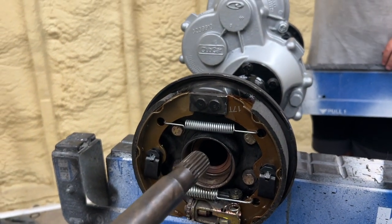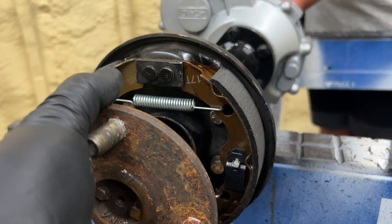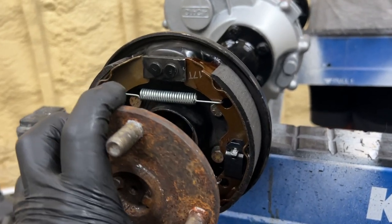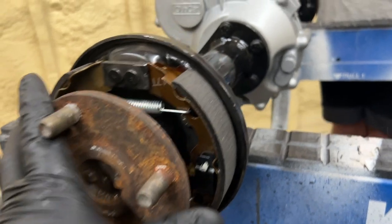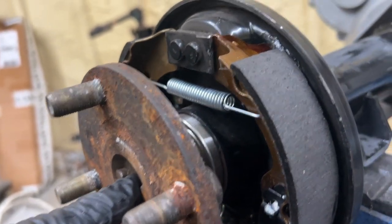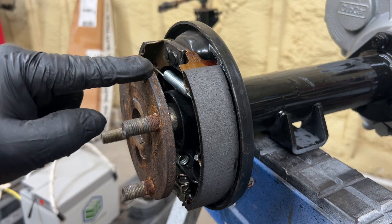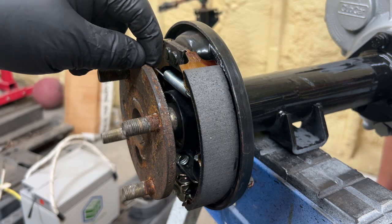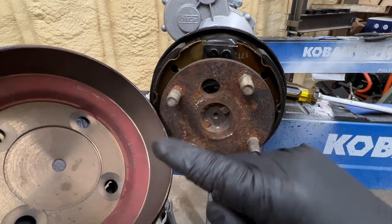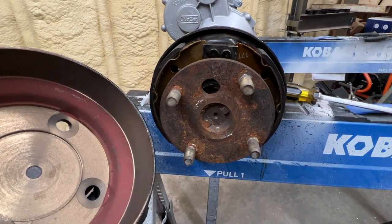The next step is to place the axle back into place here. Be sure to line up the splines inside the housing with the axle. You can see here it's not wanting to go all the way in place — you could take a hammer and tap on it, but I'm going to take the air chisel and drive it in. Once you have the axle in place, go ahead and put the C-clip back into the axle housing. Before we put the drum back on, take some brake cleaner and spray it out to get any factory grease used for shipping away from the drum itself before you slide it into place and try to use it.